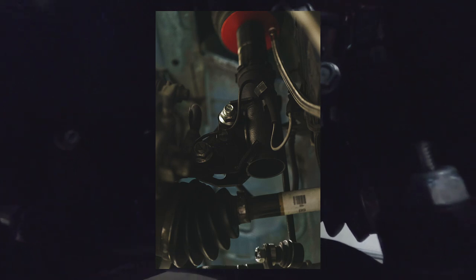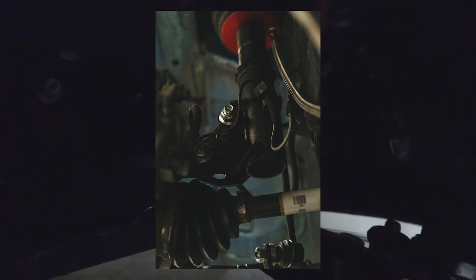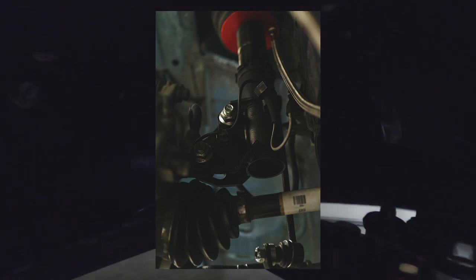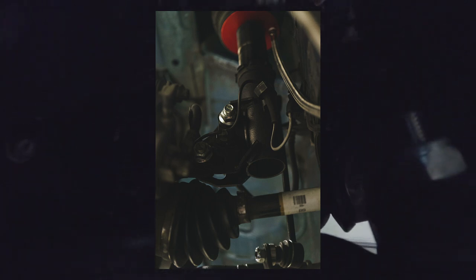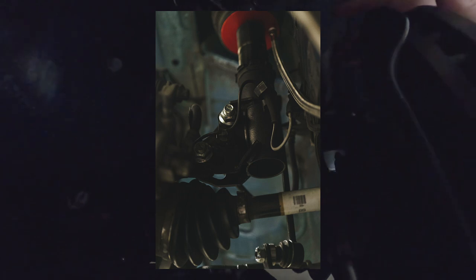and they will most likely not work. All right, so one of the things that I did to get more front camber, and this isn't necessary, is I ended up getting custom strut brackets made. You can see at the bottom it has a way bigger slot, so I can tilt the spindle just enough so then I can use the LCA extensions.